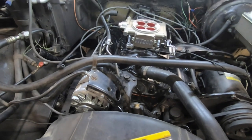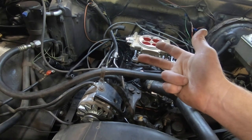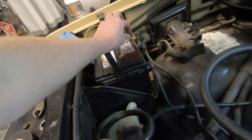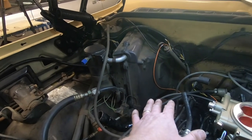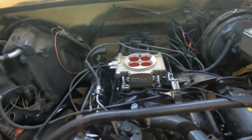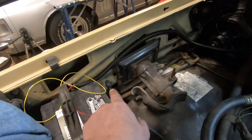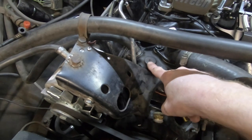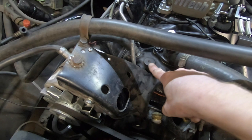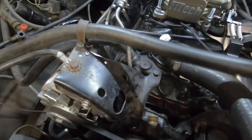Okay, so where we are right now is we've got pretty well all of our wires run. We've got our tach signal, our AC, and our constant power. Our switch power. Constant power is over here in the battery. That will be the last thing we hook up. And we've got our orange wire going down that will plug in once we get the fuel tank and everything all situated. I've run some wire loom up over the AC box here, so it's neat running down to the battery. Our last thing that we have to actually hook up and plug in is the coolant temperature sensor. We're going to drill a hole here in this spot, which is actually provided, a water jacket, for the coolant temp sensor, and Dad says he's got a tap that size that will do that for us.